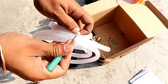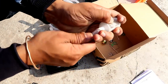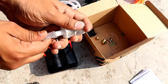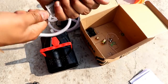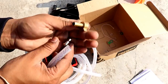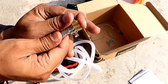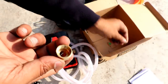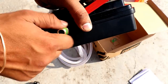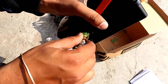First, let's fix the inlet pipe. Put the metal piece on the outside — there is a tiny hole, so you need something to prevent it from slipping inside the water. Put it on one side. After putting the other end, you get some attachments to add. Fix the clamp here so the pipe fits properly. When you have this attachment, put a plastic washer and then tighten it to the inlet port. Then put the inlet pipe in like this.